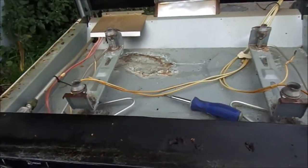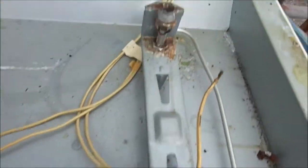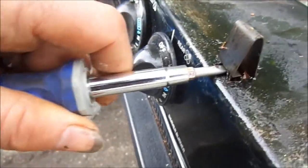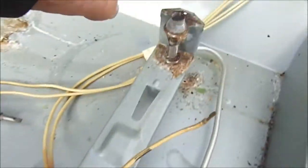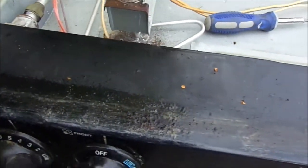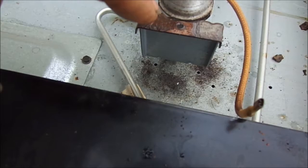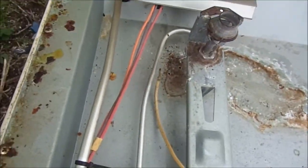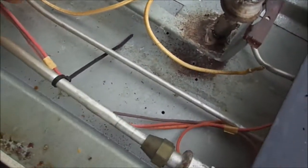I took the top off. The top is held on by these screws, and you have to take these screws off before you can disengage the top with these clips — the clips use a flat head screwdriver action pressing in and then it pops up. But you also have to disconnect the burners and take these screws out. These are actually star torx screws holding the top panel on to the burner. Be forewarned: if you try to take the top panel off without disconnecting the burners, you will bend the feed tubes — and possibly break them. Once you put a kink in the feed tubes they will not be safe anymore because there's a possibility of them leaking.